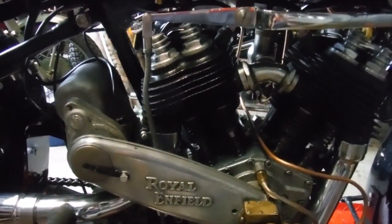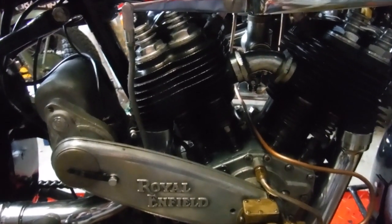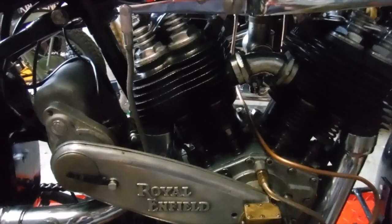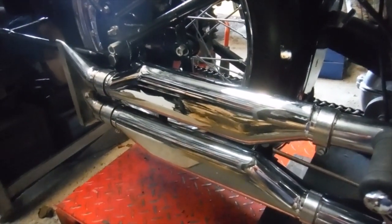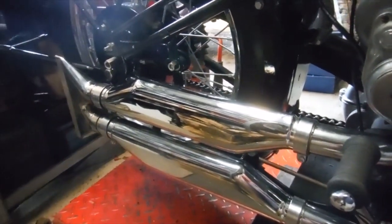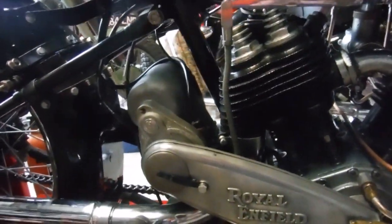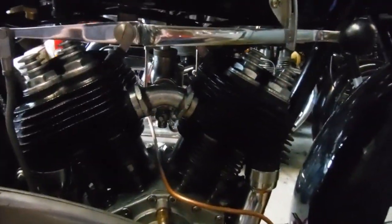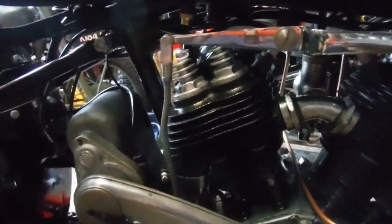But on turning the engine over and finding that the points were opening for each cylinder where there was compression, and having heard occasional bangs from the silencers indicating that the spark was happening at totally the wrong time, I've swapped the plug leads over and I'm just about to get ready to start trying again and see if we get any sense out of it.